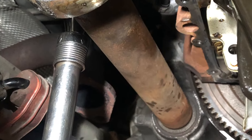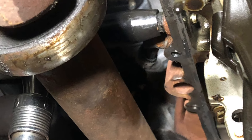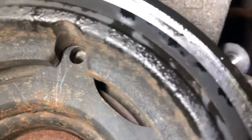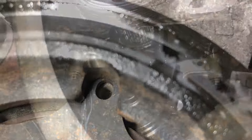You will need to remove the driveshaft bracket and then the plug for the crank locking tool that fits in here. The crank pulley locks through this little hole — this is very important when reassembling.